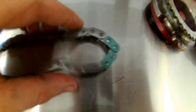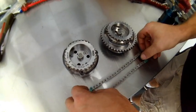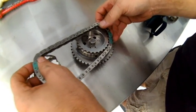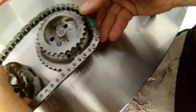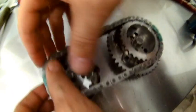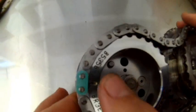You can see the chain is actually set up with two links on one end and a single link on the other. We're going to show the orientation of how the chain goes in regards to the marks on the camshaft sprockets. You'll see that we're lining up with dark links — in the center of the dark links we have one timing mark, and on the intake camshaft you'll see it lines up right in the center.